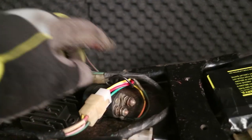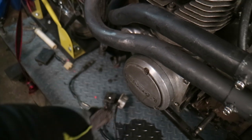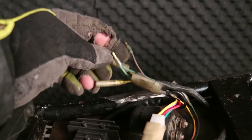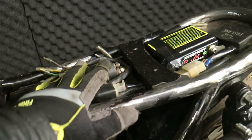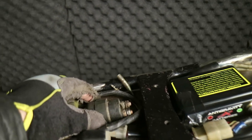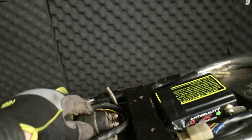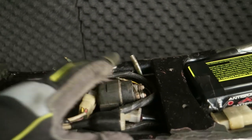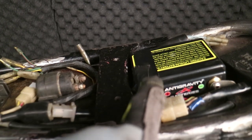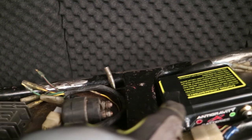Yellow is the AC signal, green is ground, and black is 12-volt positive. The new rectifier regulator takes care of both by directly plugging into the harness, which is quite nice. There's an extra black wire that goes into the harness where the original black wire for the original regulator came off. The other two wires — ground and the yellow AC — don't need to be used, so those can be capped and put away. I'm not really using the starter in this scenario, but I wanted to have it wired. I have the starter solenoid here; I've modified the bracket slightly so these two wires run flat, and my two main leads are just sitting there.